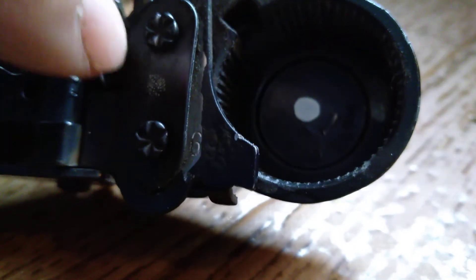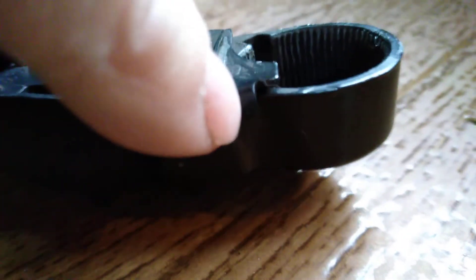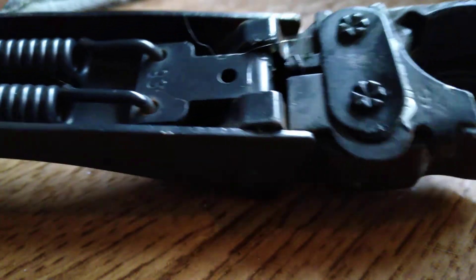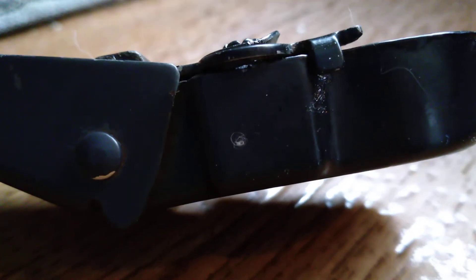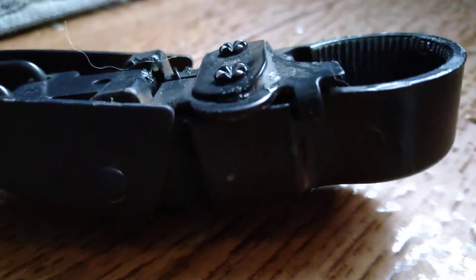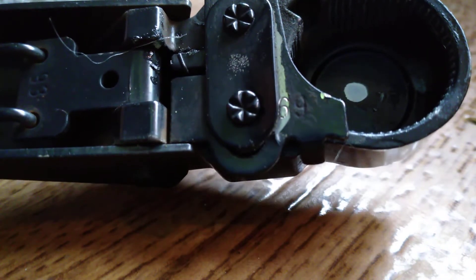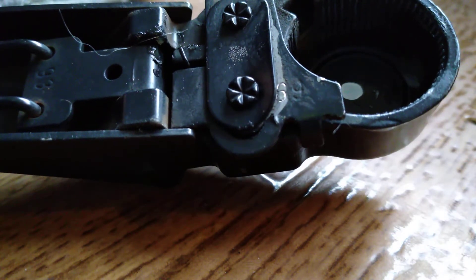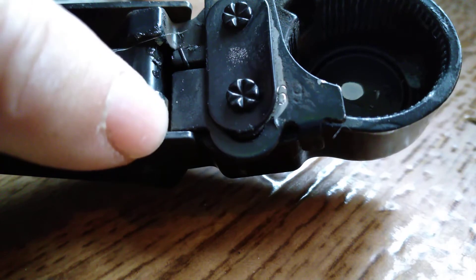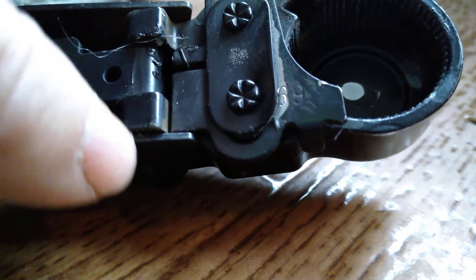You're going to be sliding it down from the tab side. As you can see, there are a couple of springs there, and the springs keep it to your windshield so it won't slide down or away from the splined area just sitting like it is — because this part right here is running into the side of the wiper arm, so there's no way to slide it.